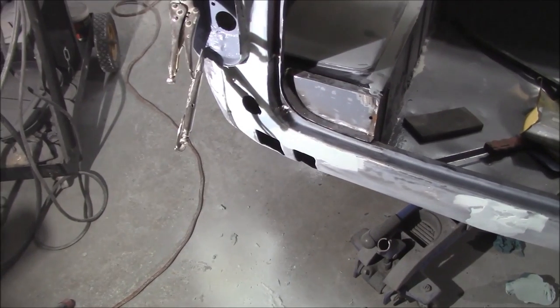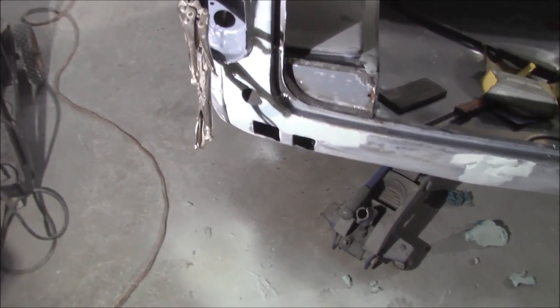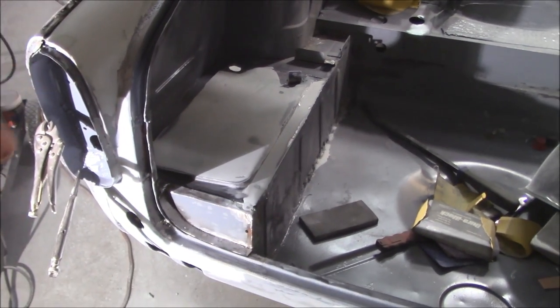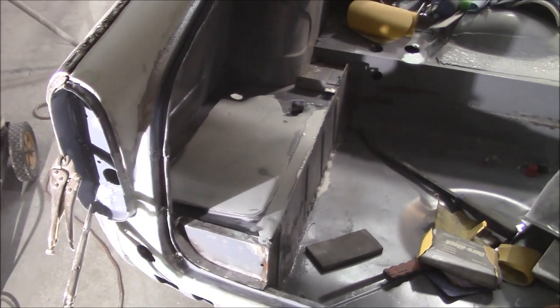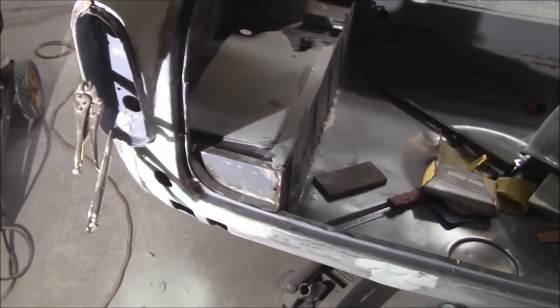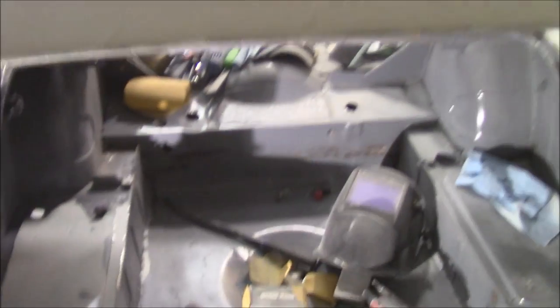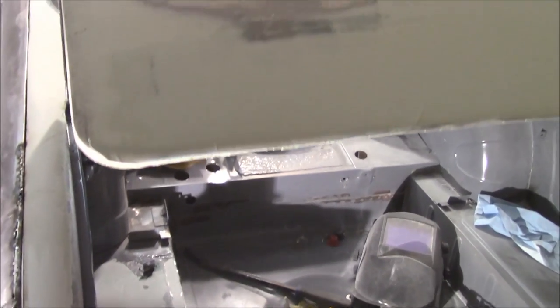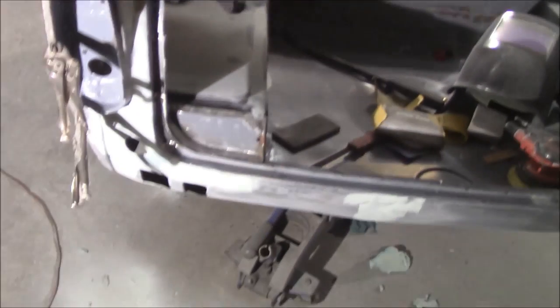We're making progress on the bottom left-hand corner, the driver's side, and started doing a little work on the trunk's rear shelf which was in pretty bad shape - pretty pitted. We've done a coat of fiberglass first and will smooth it out with Bondo. I also put another scratch coat on the top of the trunk lid to get rid of a low spot there, but haven't sanded it down yet - that's another job to do.